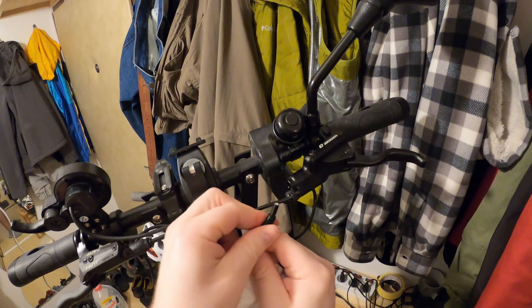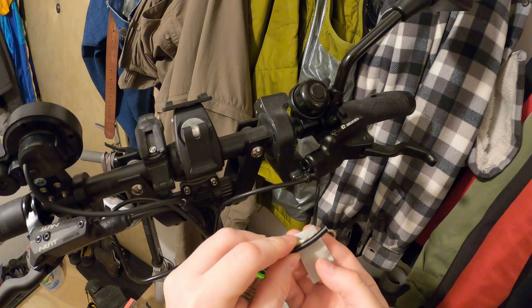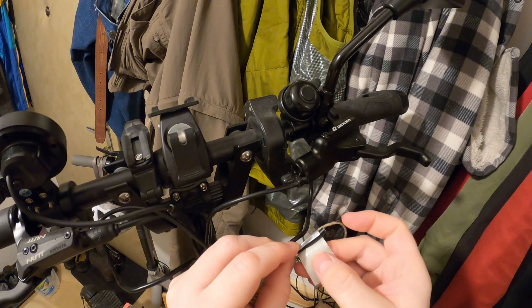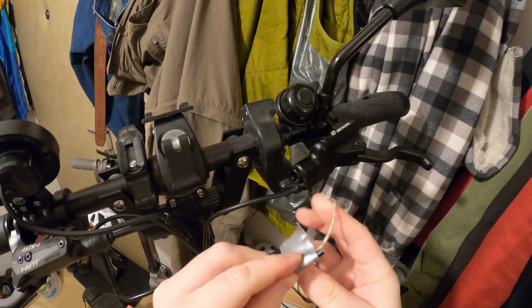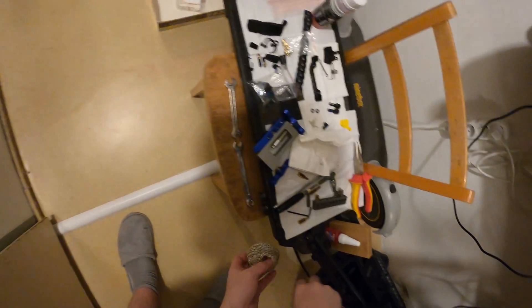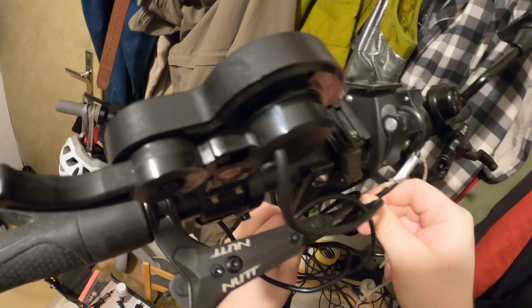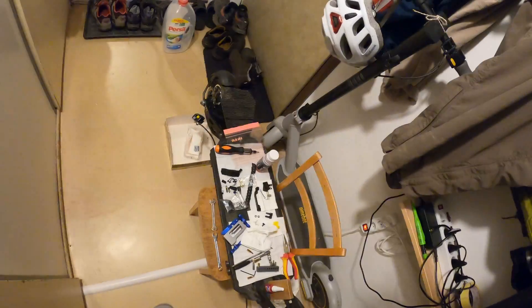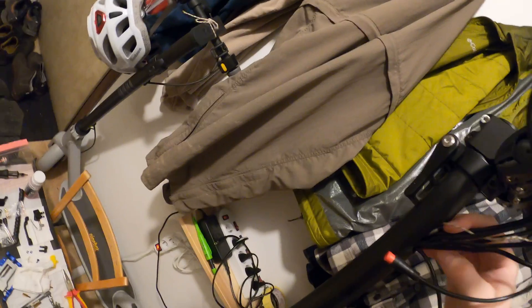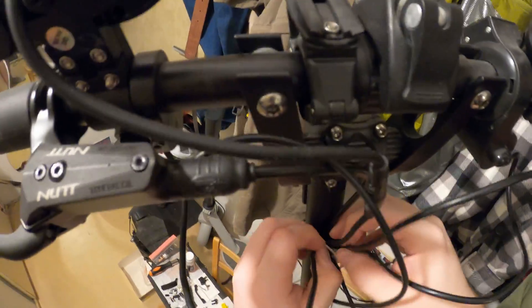You also need to remove the nut and the protective plastic cover. Before you pull the old oil line or brake line through the scooter stem, make sure you tie some string to the end of the line before pulling it through, otherwise you will have a really hard time pulling the new line back up the stem. Once you have the string secured, make sure it's long enough — especially for the back brake — so the string goes all the way through the stem and through the deck. Make sure the string is well secured to the oil line so it doesn't come off. If it gets stuck on the other wires just wiggle it around and it should come through the stem.